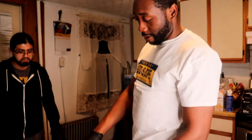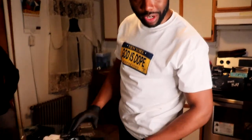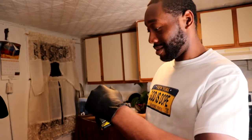Now we got our CPU in there. It's trial and error — the fan that I bought for it actually didn't fit the motherboard, so I'm about to send that back. But this is the fan that came with it in the box and we managed to get that on there nice and tight. Now it's on to some more fun stuff, like RAM. I love the Vengeance brand, so I just kept going with Vengeance — these are two 8-gigabyte sticks of RAM, DDR4.